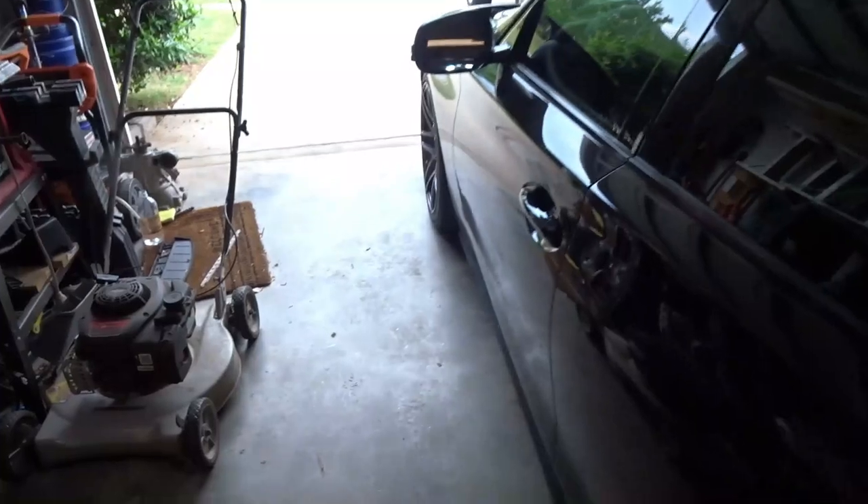We have access to the back of the vehicle. I'm also going to unplug the battery at this time, just because it's normally a good idea when you're doing anything electrical - just don't want to short anything out or whatever.